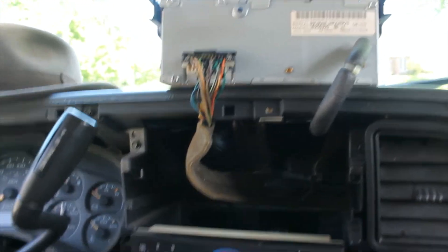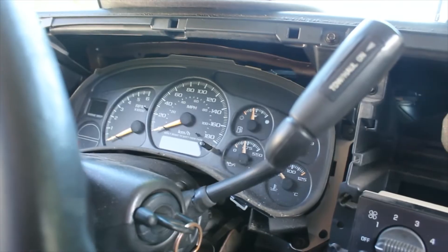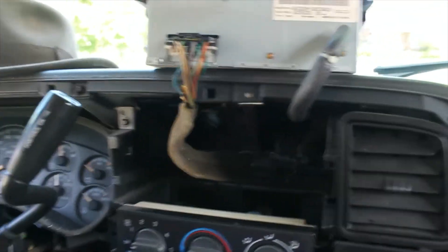I've already tested it — started it up and it works. When you pull the sensor out, it'll be in its housing with the cord on one end and the sensor on the other. There's a little clip — pinch it and pull the connector off the cord. You'll have the cord here, and that's what you stick the resistor into. The sensor itself you can just throw away.